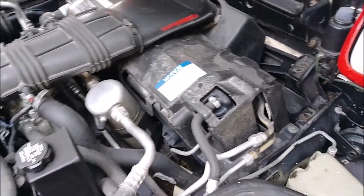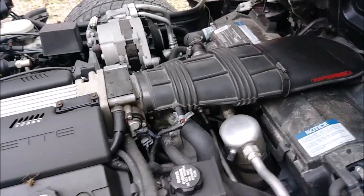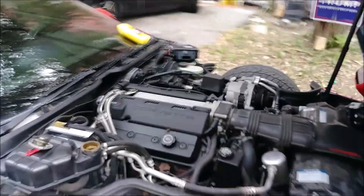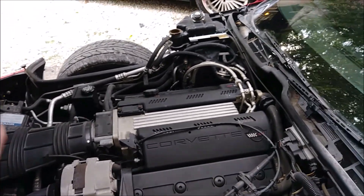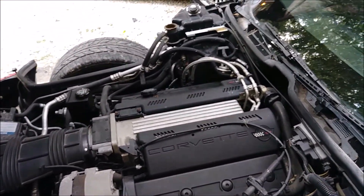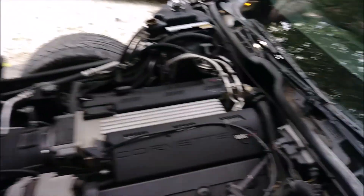I'll jack the car up because I don't believe I can slither under there. Once we open up the thermostat housing and pull the thermostat out, we'll have free-flowing coolant. We're gonna use some flush so we can flush all the orange crap out and then go with nice new green. I have two flushes just in case - what I might have to do is put one in so it seals, circulate all coolant through with the flush, drain it again, and then put the second one in when we reuse the thermostat.